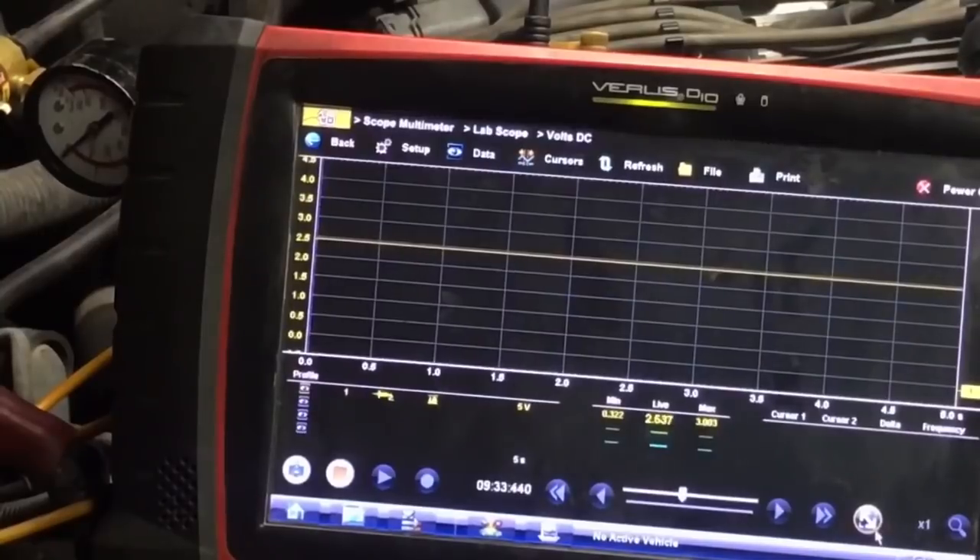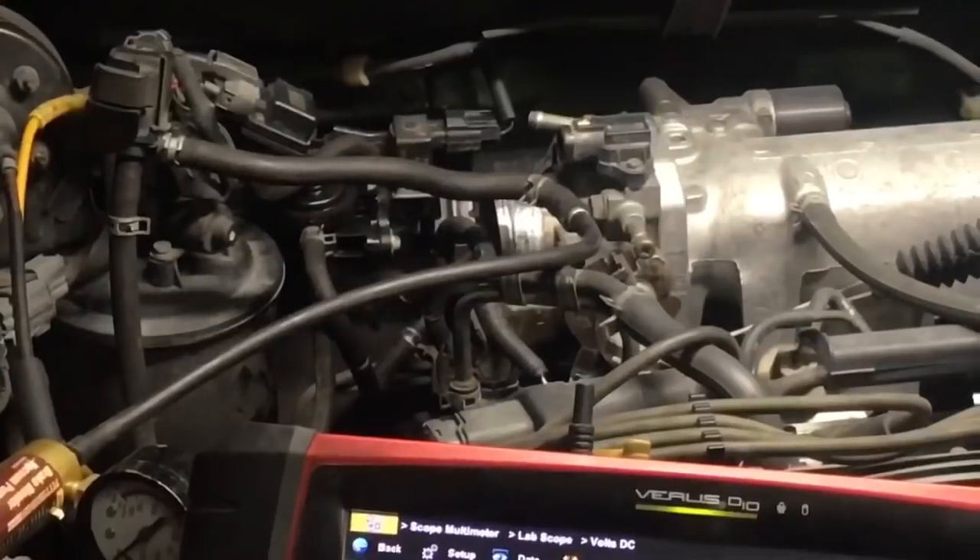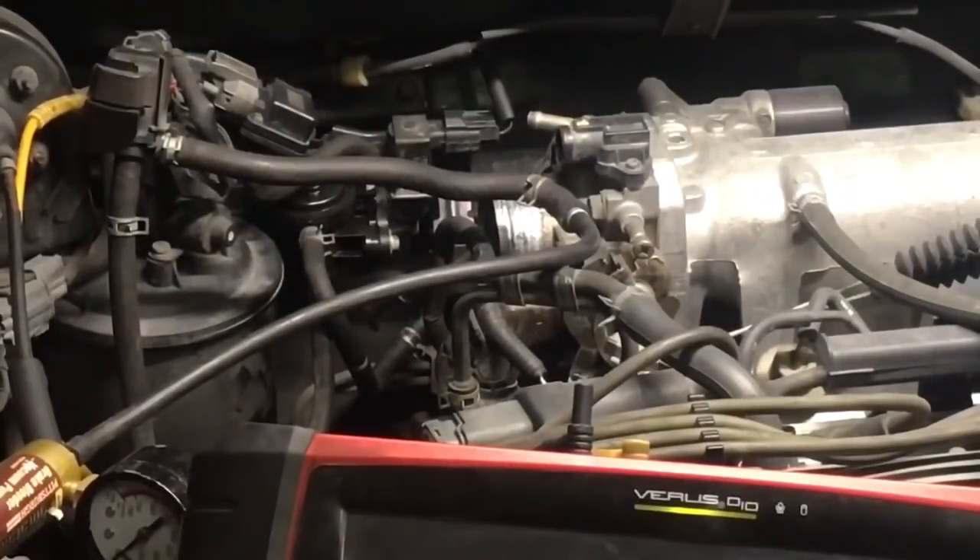I wish I could show you the other process — it was pretty cool. When I put the smoke machine, you could actually see the smoke coming out from there. On this one, a lot of people would change out the gas cap or the filler neck, but the crazy thing is the issue was right here on that two-way valve. If you like this video, please thumbs up, subscribe and share, and don't forget to hit that notification bell to get all the brand new videos coming out from Oz Mechanics.